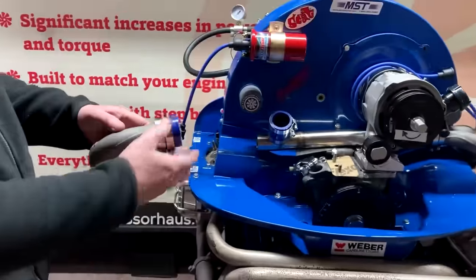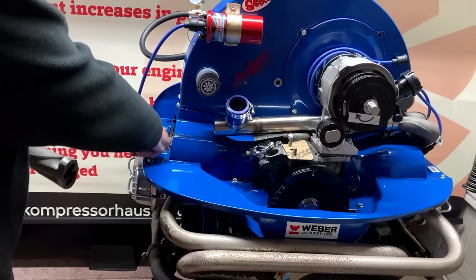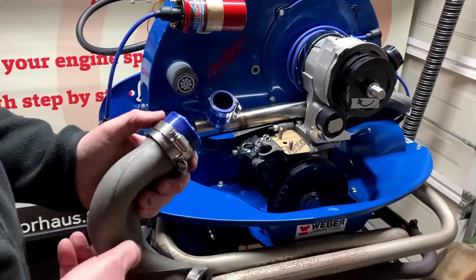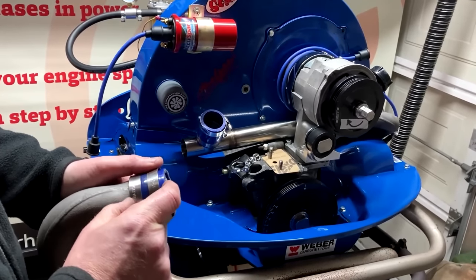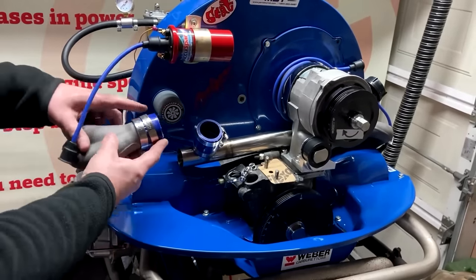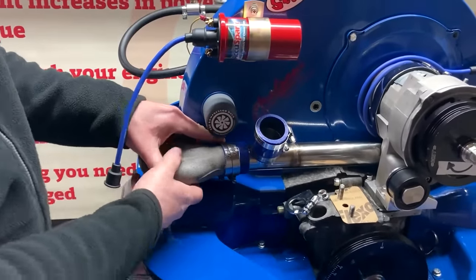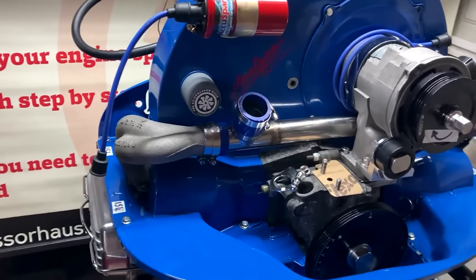Then on this side, you want to make sure that you've got your manifold ready. You've got new gaskets and you've checked all that and cleaned all of your gasket if you need to, but ideally if you're taking it off, put fresh gaskets on. Fit your silicone hose, which is a 40 mil hose, and again put your retainers at the bottom. And to fit this, lift your hose, thread it over into your silicone hose here, and then just simply drop it down onto the engine.